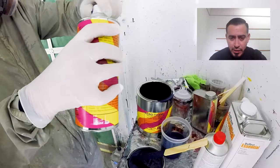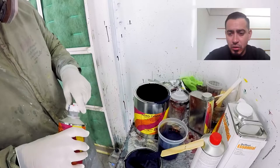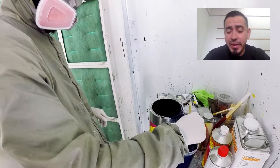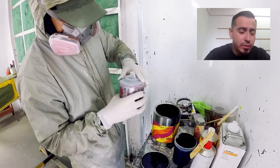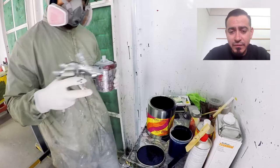Here at the mixing table we have the products we need — a mixing cup, aerothane paint, ready guns, and our guy is ready to go. He stirs up the blue and uses the proper products to mix the aerothane. The mixing cup shows the mixing ratios and there's the reducer. Once everything is in the same cup you stir it up and give the paint about 15 minutes — they call it an induction period — and then you're ready to go.